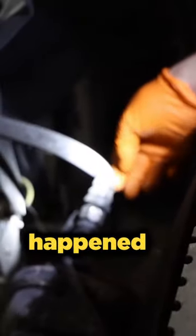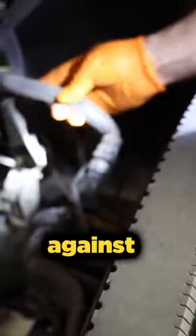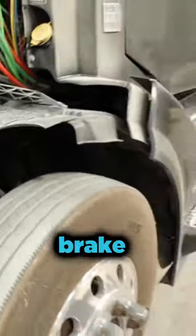The bind happened and now we've got a hose leaking. So any kind of chafing like this, if against any kind of a frame or anything like that, that's what you're going to be looking for on your brake hoses.